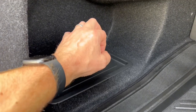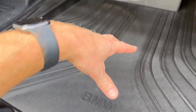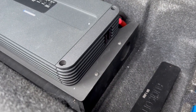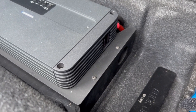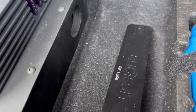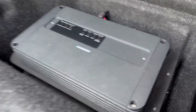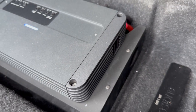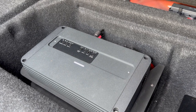The amplifiers are located down here. This car had Harman Kardon so we haven't coded it to hi-fi — instead we've installed a MOST interface that decodes the digital data and transfers it to the DSP underneath. We've made a stack mount — a steel or aluminium top plate with a hardwood base, everything on machine screws, all nice and serviceable. The bottom amplifier has the built-in DSP and the top amplifier is a monoblock. We also noticed we forgot to put the amp cover back on after setting the gains, so we'll sort that before the customer arrives!